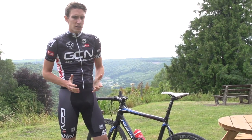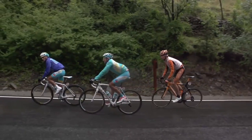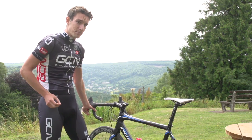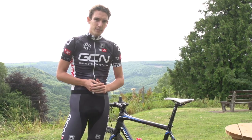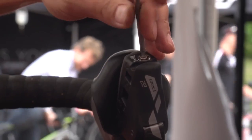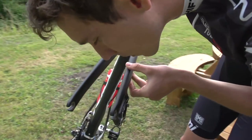One of the undisputed advantages of disc brakes is their performance in poor conditions — both the actual braking and the maintenance, because hydraulics, unlike cables, take very little looking after in poor conditions. However, just like your car, they will need a little bit of TLC from time to time. If the brake starts feeling spongy at the lever, that means you need to bleed the system — the equivalent of changing your brake cables. It's not all that hard to do, but you will need a specific bleed kit dedicated to the model of brakes on your bike. Just like rim brakes, you also need to keep an eye on pad wear, which you can check by dropping the disc out and looking at the inside of the caliper to see how much pad is left.